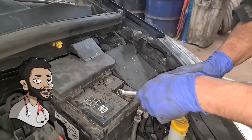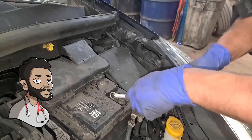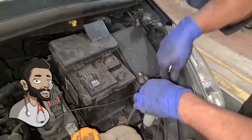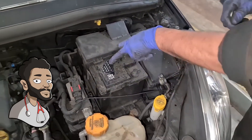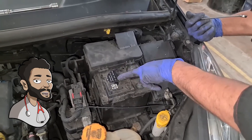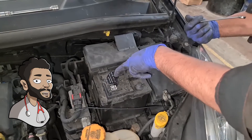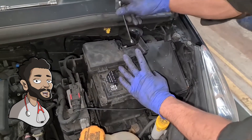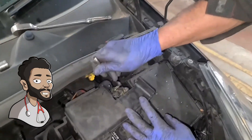I've got a new battery for this already. There'll be an option in the description where you can buy the battery from, and I'll have a link here as well. But this particular model — that's the number you always got to worry about. So this is a 360 cold crank, 50AH, 12 volt battery. Now if you get anything above 360, brilliant, because that would help you start the car up in cold weather really quickly.